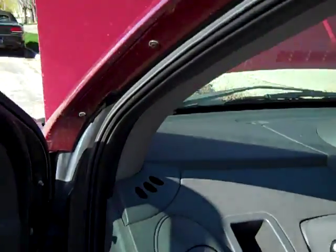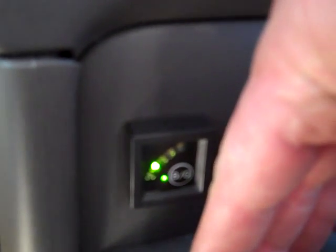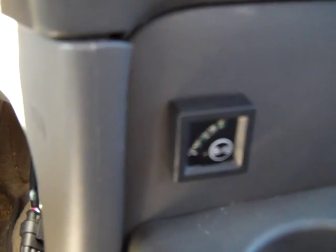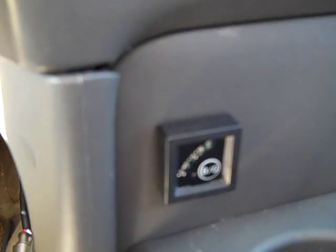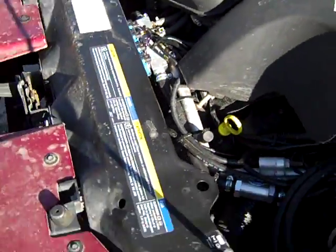Let's crank it up so they can actually hear it run on CNG and you can do the walkthrough. Right now the flashing green light indicates that it's not on CNG. We're revving it and then it gets over the threshold and the solid green light says we're on CNG. Right there — it's clicked solid green. You may hear these little injectors right there, and it's running on CNG.